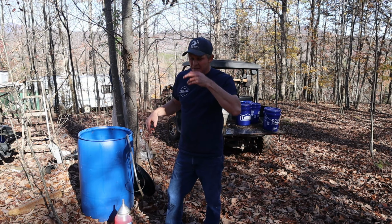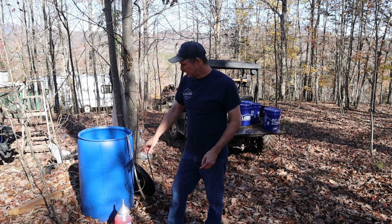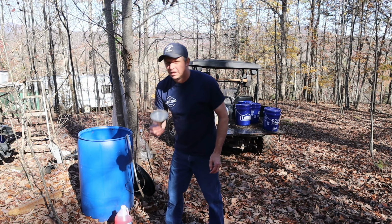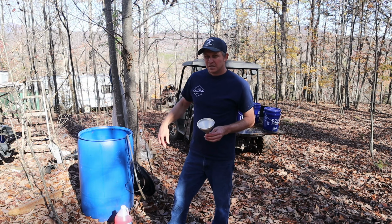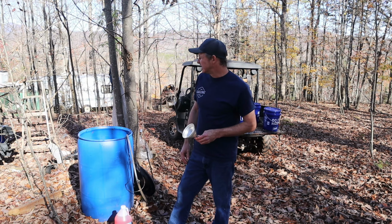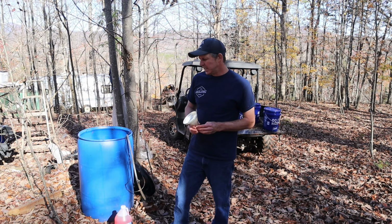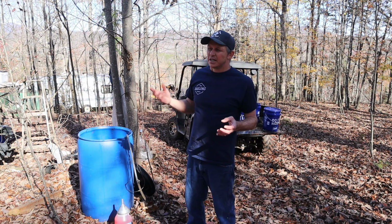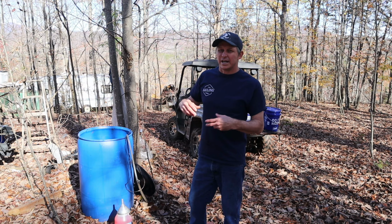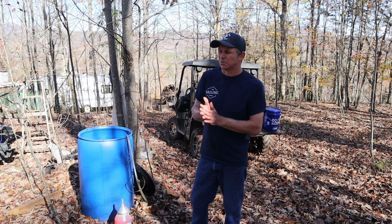Last year what I did was I ran the motor, got the thermostat open, then hooked this funnel to the hose and ran the antifreeze down in it. Because of the work that I was doing on the heater, and because like I said before, I had a busted hose that had gotten cut. And I changed that. That drained out a bunch of water.